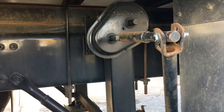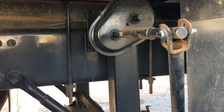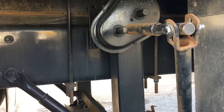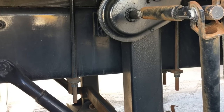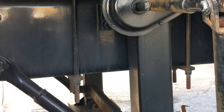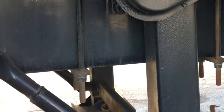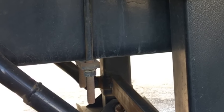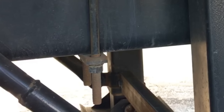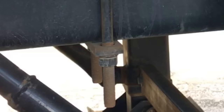There's a total of eight U-bolts located on the truck: two in the rear, two in the front, on both sides. For the first 90 days, every 30 days it's important to tighten these bolts. The U-bolts keep the box attached to the frame, and in between there's a piece of wood that gets compressed — that's why they need to be tightened down again. Every 25,000 miles they will need to be torqued as well.